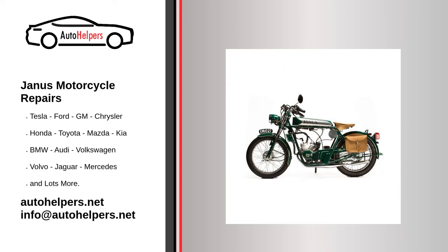A blown fuse — just like a car or truck, motorcycles have fuses, and they can blow the same way as in any other vehicle. Check the main fuse and see if it's blown. You can tell the fuse is blown by either the black material found on the fuse, or if the wires inside the fuse are disconnected. Keeping a fuse kit on hand is helpful so you can replace any blown fuses with ones that have the same amperage. If fuses continue to blow after you replace them, you likely have a more serious electrical issue somewhere in the bike's wiring.